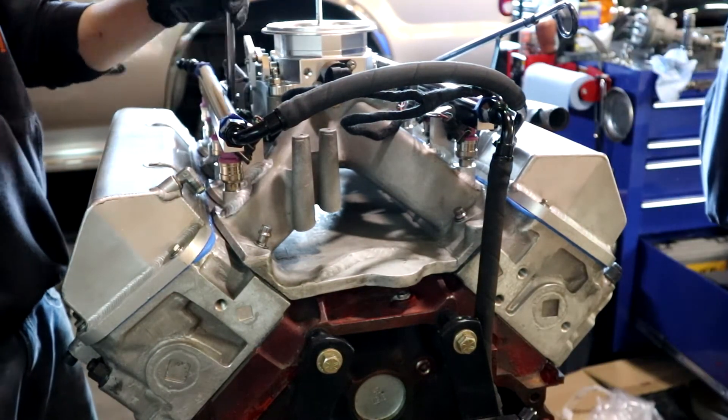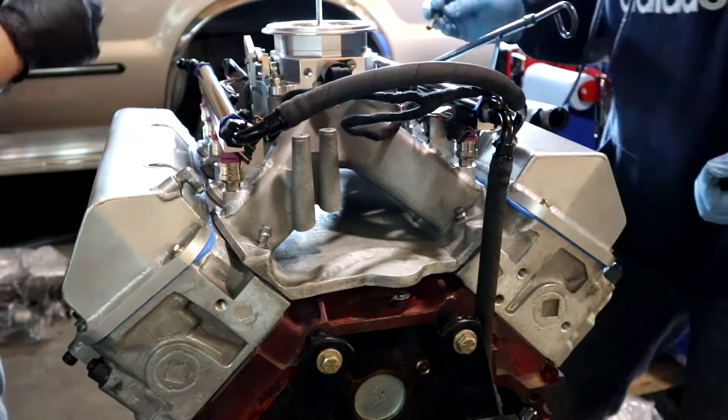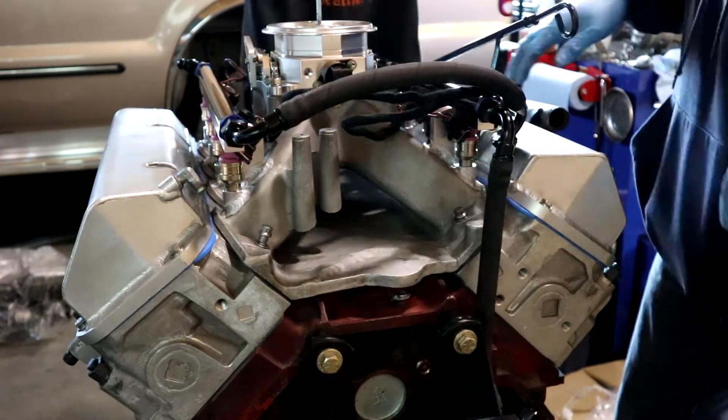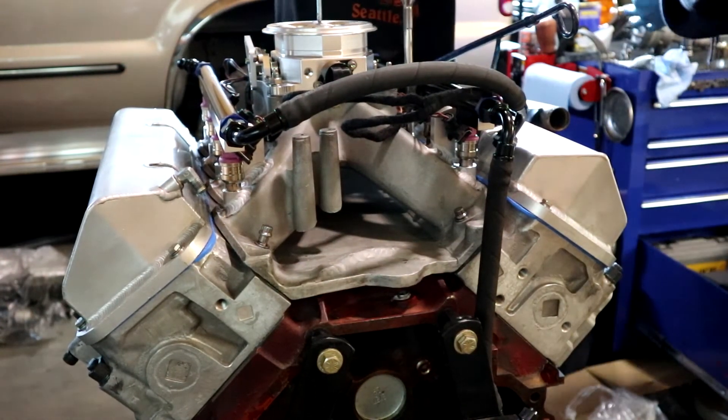You can imagine I was fairly disappointed when the engine nosed over at around 5,200 RPM — what appeared to be a float — and was only making around 300 horsepower and 300 foot-pounds of torque at the wheels.